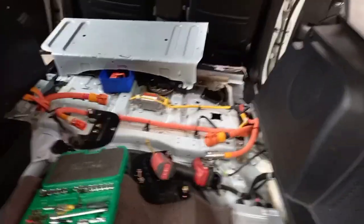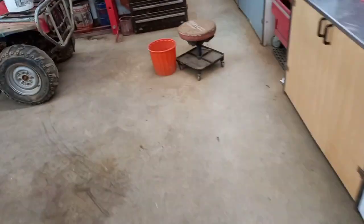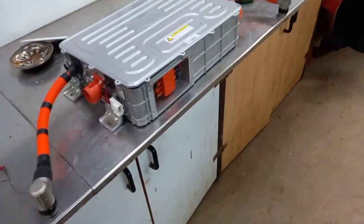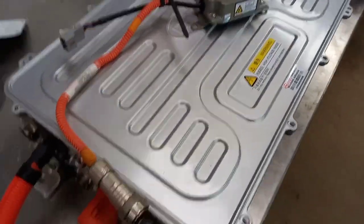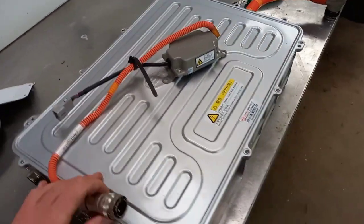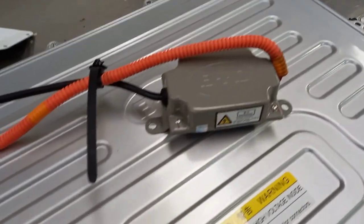For those of you who don't know about electric cars, the high voltage side is completely separate from the low voltage side, except for the DC to DC converter which is essentially like an alternator. If anything happens to the battery — meaning there is a connection to the chassis of the car — that is a very bad thing, the chassis being the negative on the 12 volt low voltage side. So that's what this little box here is looking for.